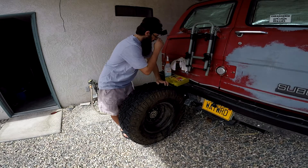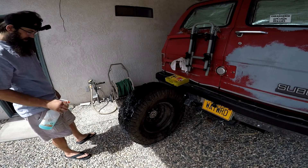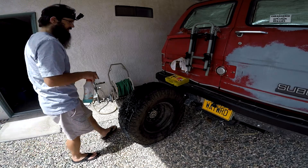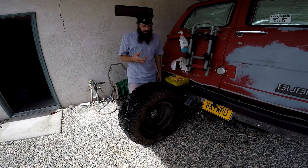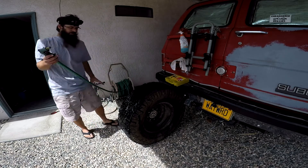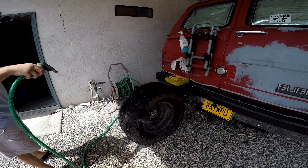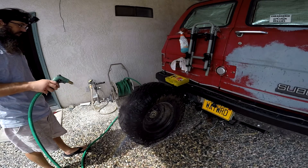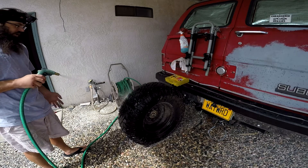Before you do that, you want to find your leak. I've already done the hard work here — our leak is right there, easy to find once you've found it. Soapy water does real good for that. If you're having a real hard time finding your leak, go get yourself some bottle bubbles — like kids' bubbles that you blow into the air — because the glycol in there will show up a leak real well. Or you can use a kiddie pool or any form of water to submerge the sides of the tire.